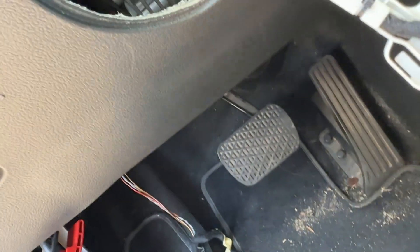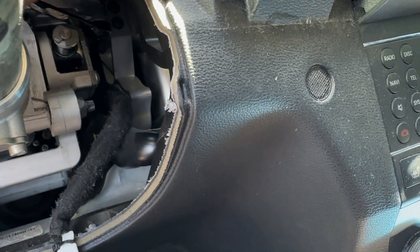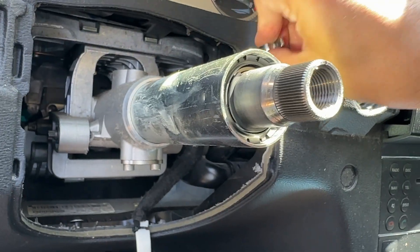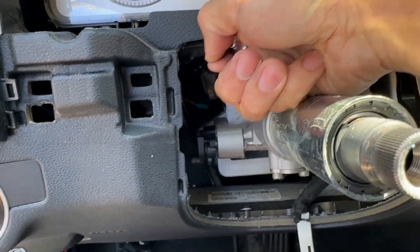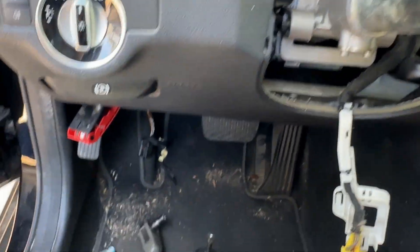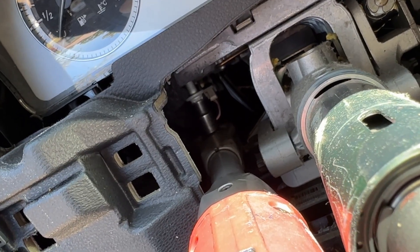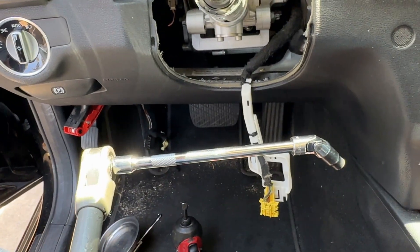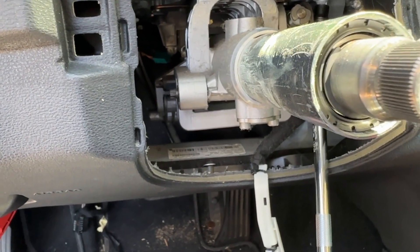For this one I like to use an open ratchet like this one here. There's our bolt — jump in here with our ratchet. That's pretty loose already. I'm going to get this one started as well. Once you've got it pretty loose, the automatic ratchet can handle the rest. For this side — this is the hard side — there's not enough room to get your ratchet in there, so I'm going to use a universal joint setup to get it off. I've got a 9-inch extension with a universal joint attached. That's enough.